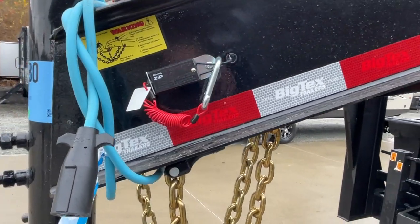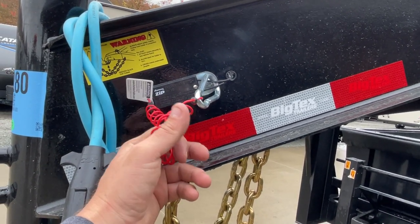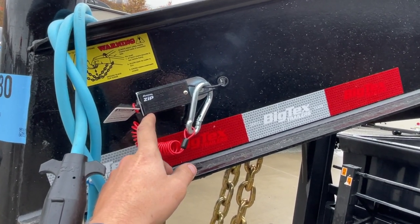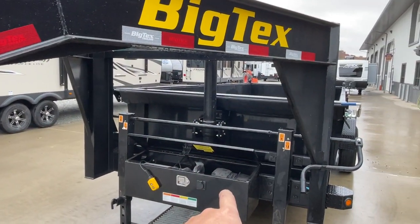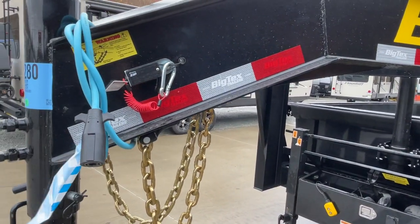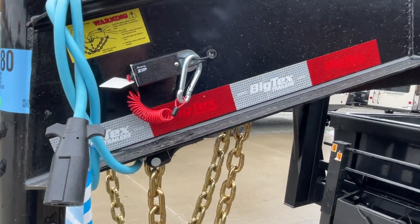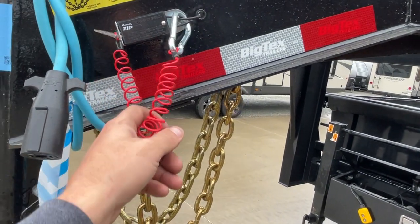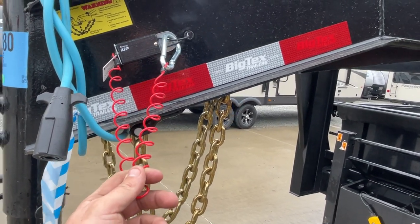But this is a Zip Fastway breakaway switch setup. If you're not familiar, pretty much all trailers or anything with brakes is going to have a breakaway cable. This is designed to be clipped separate from your chains. In the event of a breakaway or a disconnected trailer, this would pull out and energize or create a short to your deep-cycle marine battery — it's going to lock your wheels up and stop your trailer. This is nice because unlike most cords that have slack, that one obviously springs back. For those wanting a cheaper version, you can get these at the dollar store, but unfortunately they don't have the steel cable inside, so when you actually need to use it, it's just going to rip.